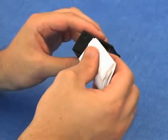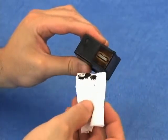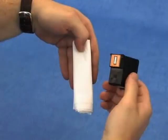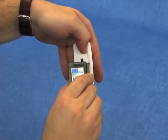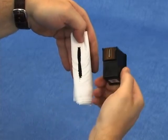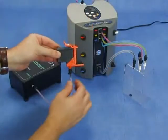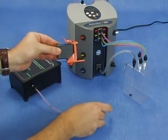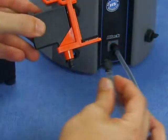After refilling your sponge cartridge, clean the excess ink from the printhead and from the electric terminals, in case they are smeared with ink. Test your refilled cartridge on absorbing paper, checking whether the printed lines are unbroken. Okay, the cartridge is refilled. If you would like to refill another sponge cartridge, make sure the cartridge is empty and repeat the refilling procedure.